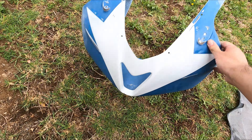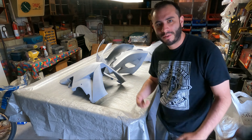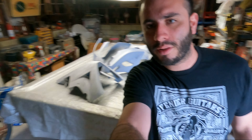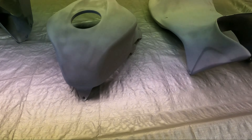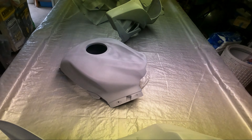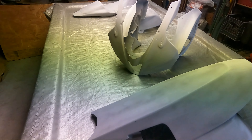I think the primer is going to get a good stick, and we'll see what we're going to do with the paint job. This side got a little trashed up but with hours of sanding it's getting much better. The bike will live again! We've got one layer of primer on and I'm going to throw on another soon. This side was all scuffed up in the accident — threw a little glass in there and some bondo on the outside, it came out all right. But this was probably the biggest damage up here on the rear piece — you can see all that fiberglass I had to lay in there to get it repaired. Everything's looking good. I think we're going to go with the matte black and everything's going to be looking cherry real soon.